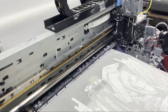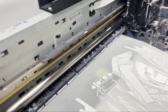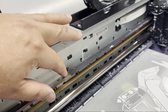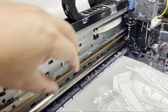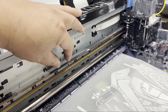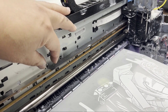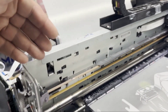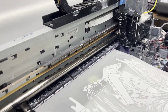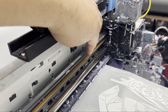When you hear a high pitch sound followed by double blinking lights, usually you have some ink on the clear belt. This clear belt has little marks so the print head knows where it is. If you have a stain here, it blocks the distance reading for the print head, so the print head doesn't know how far it has moved — and it gets stuck here or there. My first reaction was that there must be an ink stain on the belt.